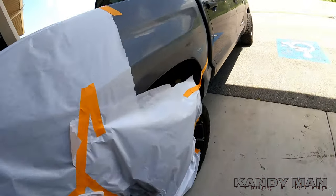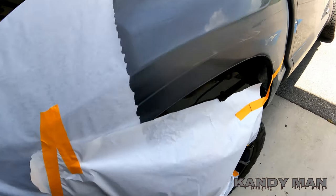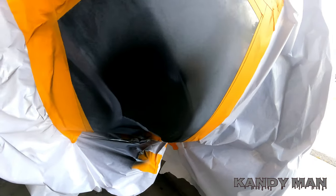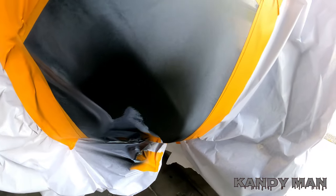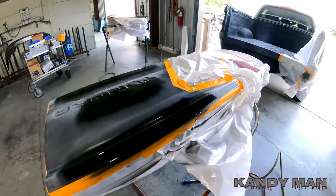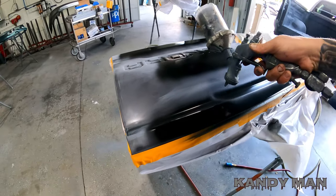We already got this bedside prepped out and partially prepped. We cleaned and scuffed it, then we got to sand it a little more and scuff it a little more, but that's why we got this taped up so small to keep overspray off it. So once this dries, we can go ahead and roll with it. So I just wanted to show you, see how it's got that gloss? It'll show any imperfections real easy for you, being it's shiny. And it just is a good primer, and it's fast, it's good, it doesn't die out, doesn't suck in, doesn't shrink. And it's pre-flex, so some of the best primer I've ever used. And they want you to put it on back to back with that AS8 because it kicks so fast, so they just want you to back to back it.